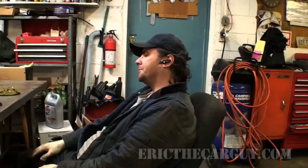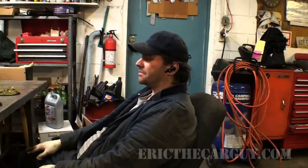What else? Oh, power steering fluid was completely empty. I filled that up, but it wouldn't engage until I revved the engine up. In other words, it wouldn't start circulating, so I revved the engine up, and finally it started circulating through. Had a very similar experience on the HydroBoost van. I don't see any leaks. All the fluids are renewed. Transfer case, engine oil, everything. It's all new. That exhaust leak is very small. It might just be snugging up a couple of fasteners, but I'm not doing that tonight.